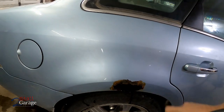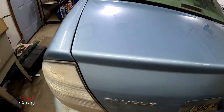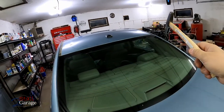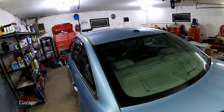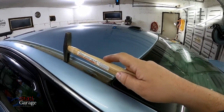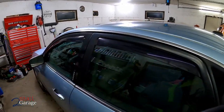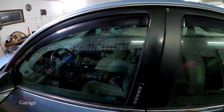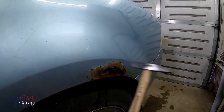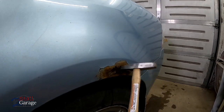All right, we'll hit that up with the angle grinder. Swinging along in the back, pretty good. Up on the top is good as well. I took the rain gutter trim pieces off because we're gonna go ahead and use that Scotch-Brite pad. Probably start with the rough and then go with the medium over this as we get those channels ready to be painted. Another corner right in here. I just cringe hitting it, but what do you do?